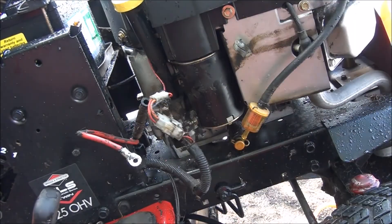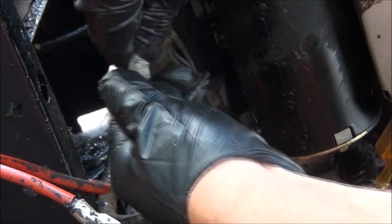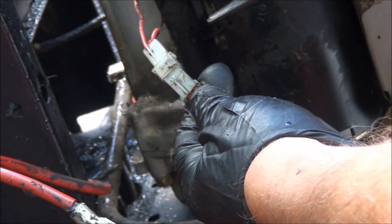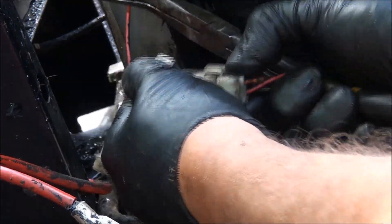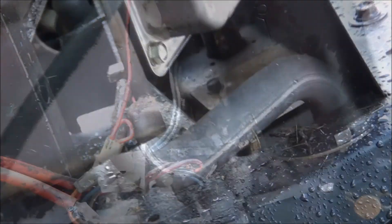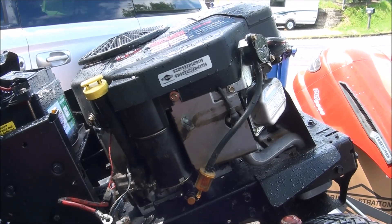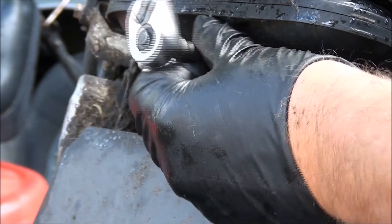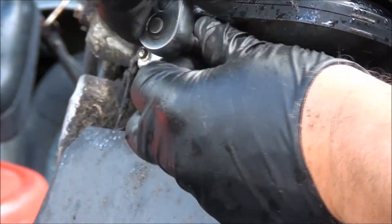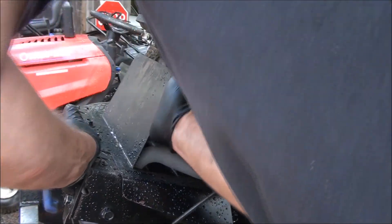The wires we need to disconnect: wiggle them and they come apart — sometimes I have to use a pair of pliers to pull them apart. This one you just squeeze each side and wiggle it and it pulls off. The engine sets in the muffler, so if you lift it straight off it'll come right out — you don't have to loosen anything up there. It looks like it's a Torx 25 bit. Loosen it just enough to pull the cable out, and as you can see where the cable mounts it pulls down and you can pull it right out.